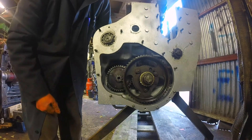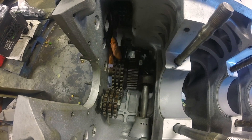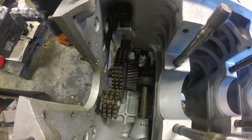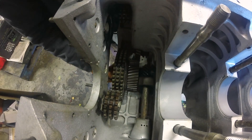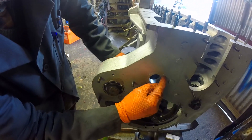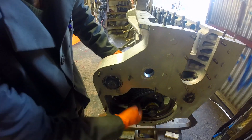The injector pump is like a little mini engine, and we'll leave that for another video. As this gear rotates, you'll see there's a kind of spiral gear here which rotates this shaft and drives the water pump, which comes in here on the side of the crankcase. There are new bearings on the idler and new bearings on the camshaft at the front. The timing chain fits around here, passes around this auxiliary shaft, over this tensioner, around the crankshaft, around this idler, and back around the timing gear again. This idler is here simply to increase the curvature of the chain around the timing gear.